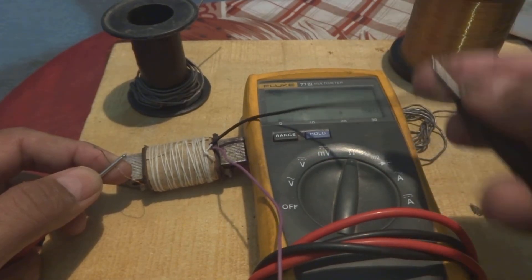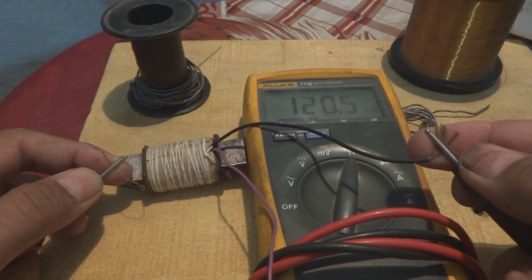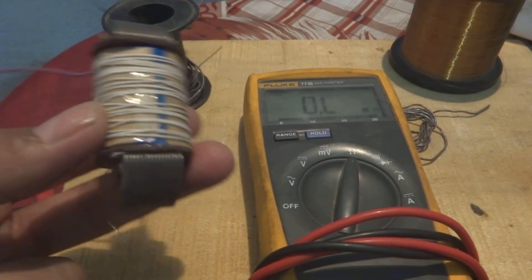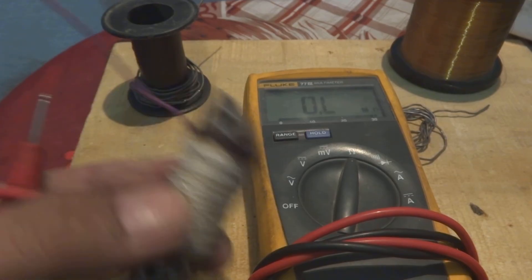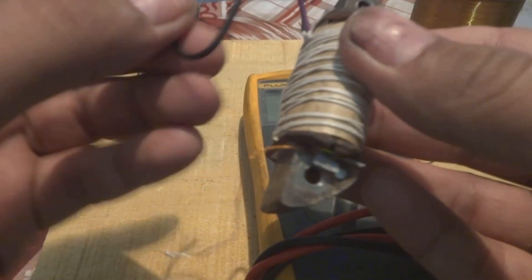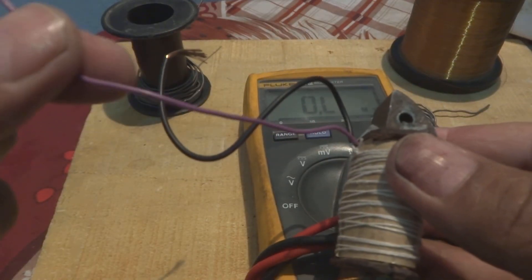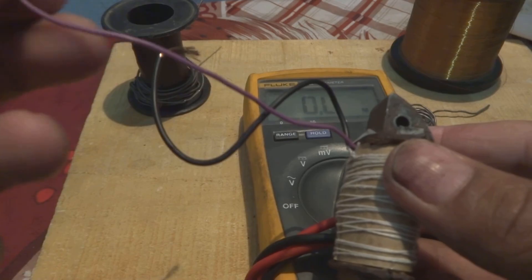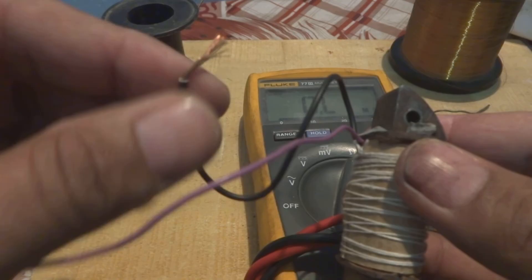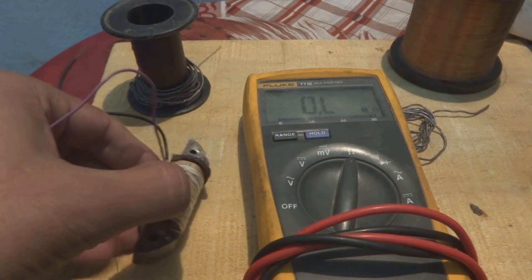And now we are going to check with the 2000 — it is giving 120 ohms, 120.6 ohms. So this is a good winding result which we can see for this core which we did. First, what we will do is we will try this wire and keep it somewhere — we will secure the end of the wire with the tape, and we will use this wire for starting the bike. Then we will see the result: if the voltage is sufficient, we will use this one. Or if the voltage is less, we will secure this wire somewhere and use the other one. This is the hit and trial method — in two windings, we did it.